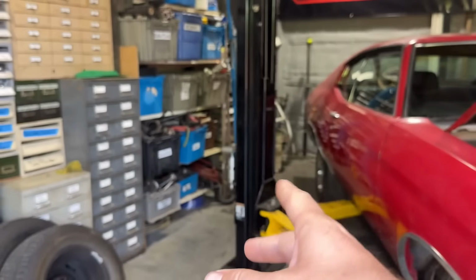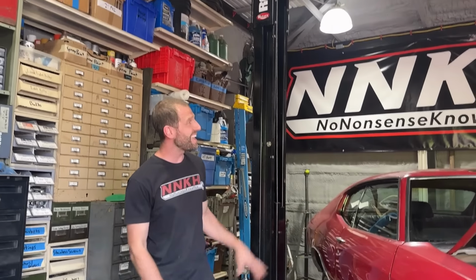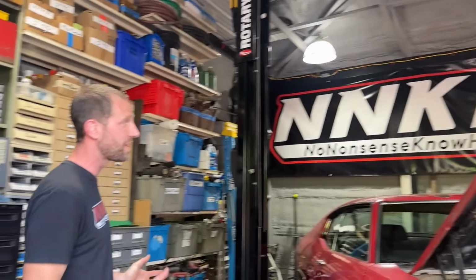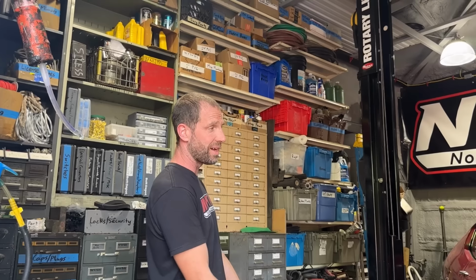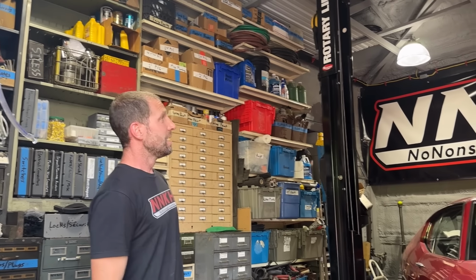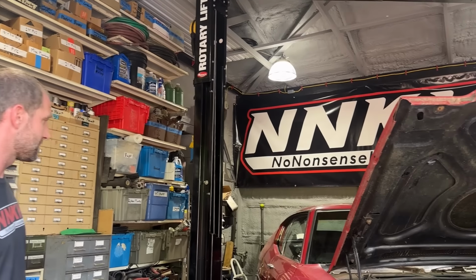Where'd you get your 2-post lift? Did you buy this used? Yeah, I got this used. It's a 10K asymmetrical, which I wouldn't recommend. I always worked on symmetrical lifts, and actually in-ground symmetrical, but I don't like the asymmetric thing, so I've been putting cars on backwards anyway.